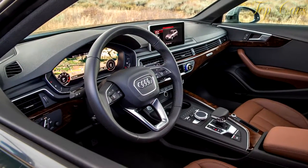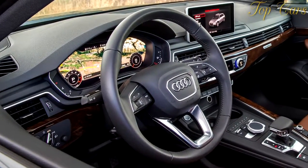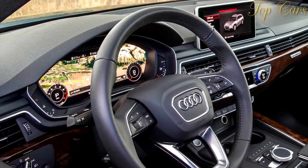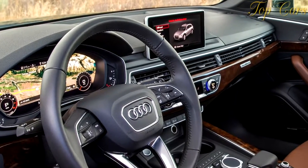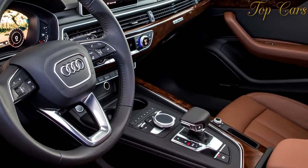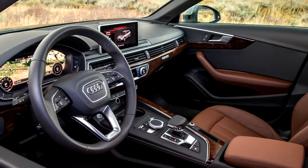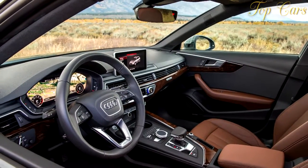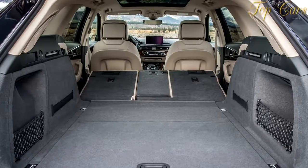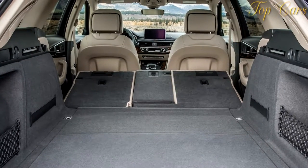The only other attribute that makes this Allroad special is its new all-wheel drive system, marketed as Quattro with Ultra technology. The Ultra business of this system dumps a center differential for a pair of clutches, one at each end of the rear axle's drive shaft. Under most conditions, the Allroad functions as a front driver for a slight bump in efficiency — not spinning the drive shaft saves precious drops of fuel, and said shaft can be re-engaged in as little as 0.2 second. While it is an understandable step toward meeting CAFE regulations, we also see it as a heretical departure from the traditional all-wheel drive Quattro canon. Expect the system to appear in other Audis, although all S and RS models will continue to use center differentials.